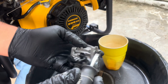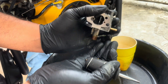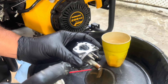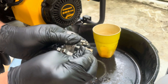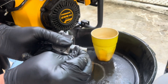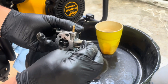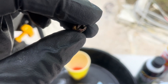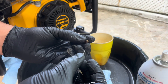Let's remove the emulsion tube as well and see how it looks. Now let's talk about the main jet — this is the main reason why generators won't start. See how small that hole looks? Let's clean it up and see how it really should look.